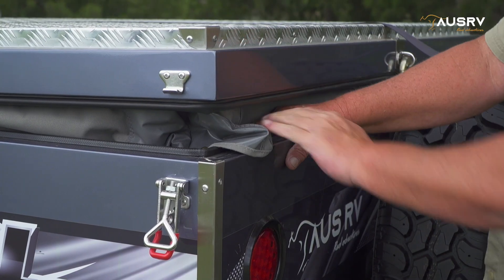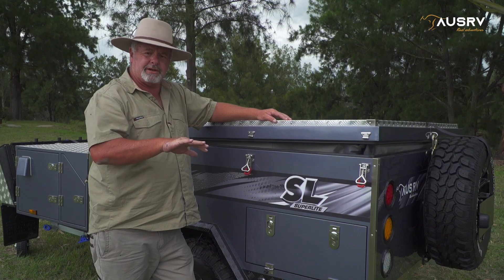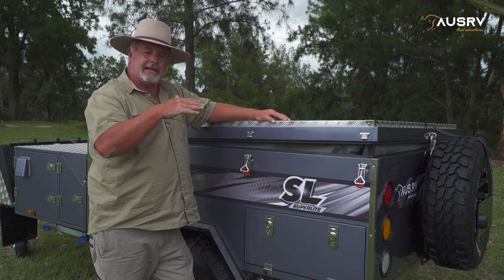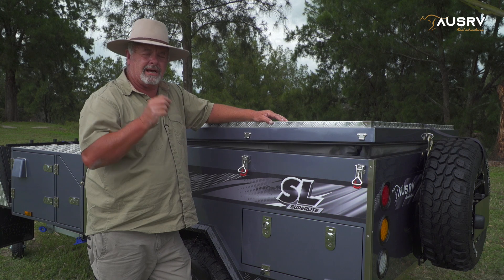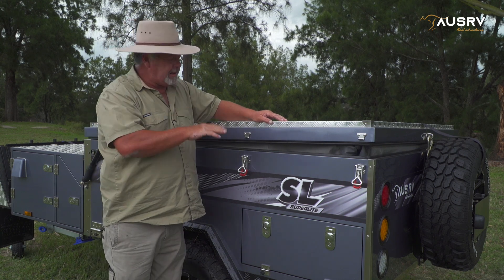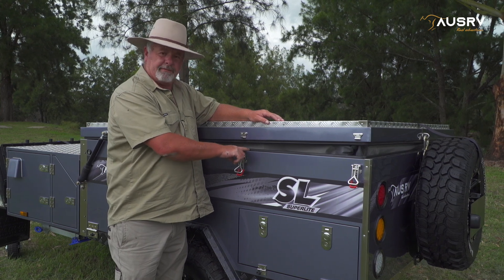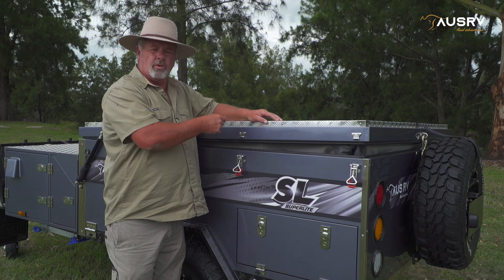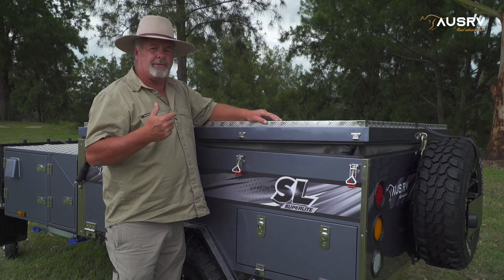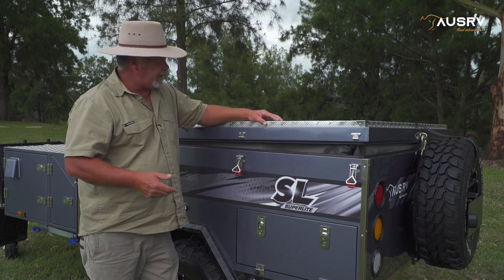I've gone around the camper and made sure all my canvas is tucked in properly, especially across the front, and made sure that the vinyl draft skirt that goes over the lid and the hinges isn't poking through and going to interfere with the seals. It's critically important that when you pack your camper up there is nothing protruding between the seal and the lip of the camper. If there is, you can wick water into the camper if it rains, and with a bit of heat you'll have mildew on your canvas, which nobody wants.